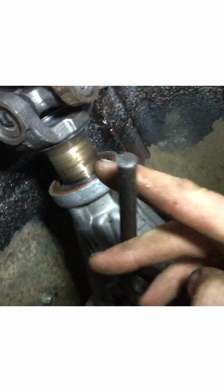Trash Metal Customs, and I'm taking a break from working on other people's stuff today and working on my own stuff. Let's see what we got here. For my transmission, I got a Turbo 350 in this, and I've been having an issue with it dying when I come to a stop. It'll swing super rich, and then it'll die, super annoying.